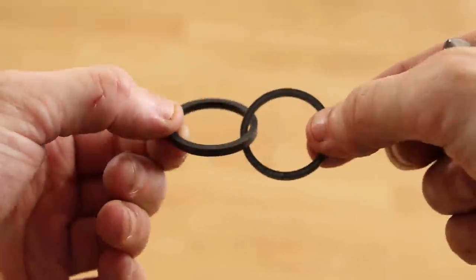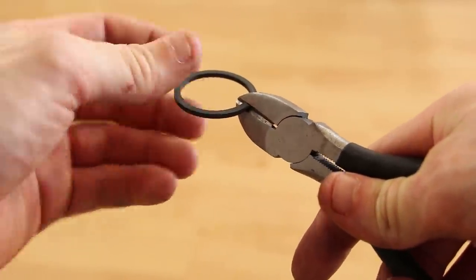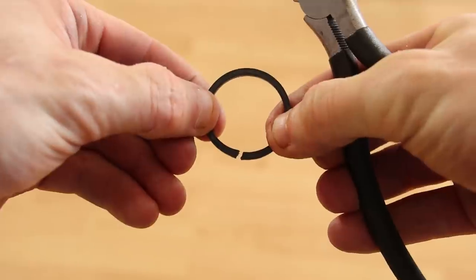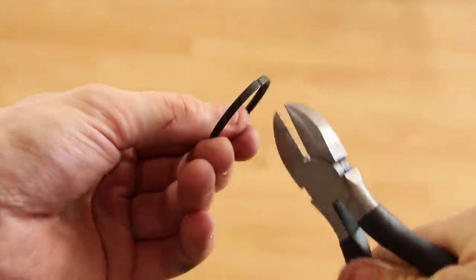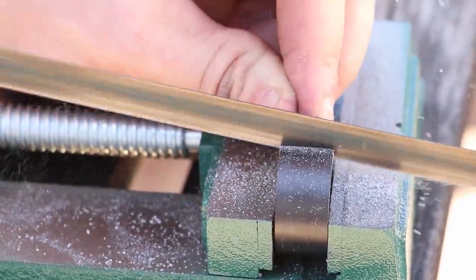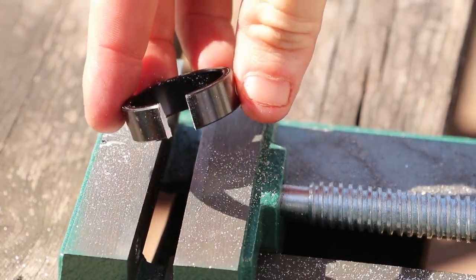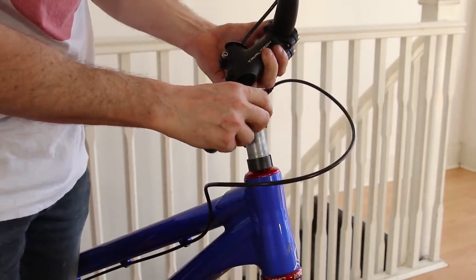With one simple change we can fit them without having to touch the brake. It's as simple as snipping the spacer to allow it to flex open and around the brake hose. These are small carbon spacers and are easy to cut, but it's also possible with thin alloy ones too. These small ones now easily snap over the cable, but what about bigger spacers? Bigger spacers won't flex open as easily, so instead a slot big enough for the hose to pass through is needed. This works for alloy or carbon — just watch out for the dust. Now you can add or remove spacers quickly and easily, ideal when you have a new bar, stem, or even bike and you want to try different bar heights.